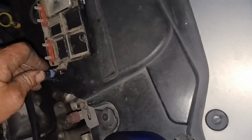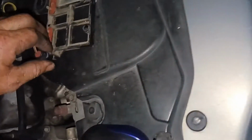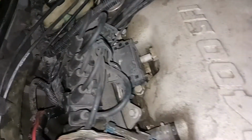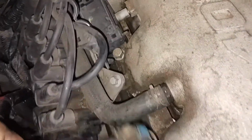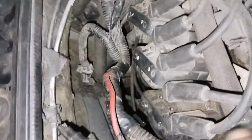Alright. So, that will plug in. Bam. Alright, so now I've got to figure out the 5.5 millimeter to get the coils off of the ICM so I can swap the ICM, because I didn't really bring any of my small sockets. So I think the smallest socket I have is an 8. So let me figure something out and I will give you guys another update.